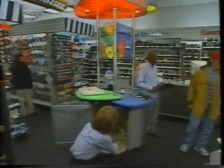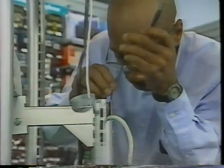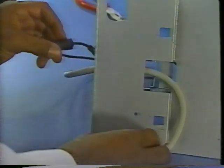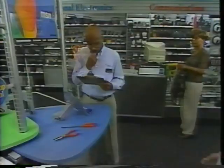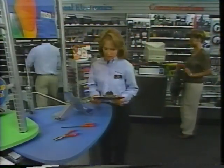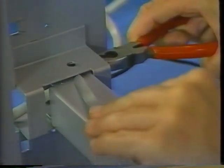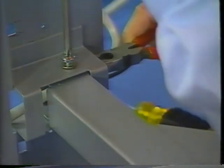Next, place the monitor's power supply inside the fixture. Connect it to the power strip, then feed the monitor power cord up through the center support pole. Don't put it through the collar ring, though. Then, feed the end of the power cord through the monitor bracket face. Next, we're going to reconnect the monitor bracket face to the monitor bracket arm. You won't drive yourself crazy fitting all of those washers back in if you keep the screw hole towards you and slide the washers between the bracket face and the arm.